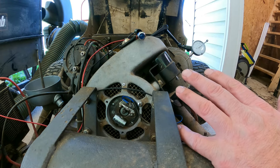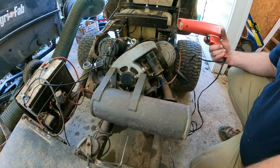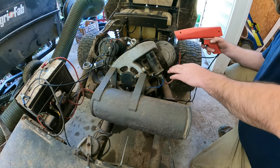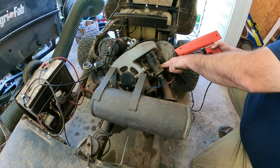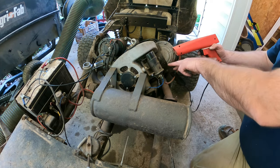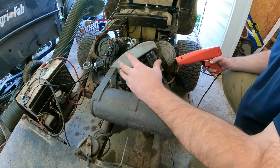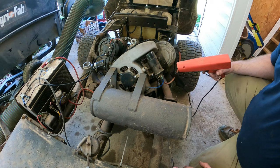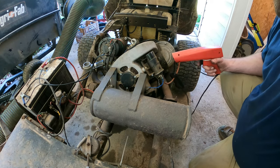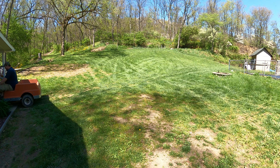One other thing you can do to check the timing is use a timing light. Jack up the rear end, get the tires off the ground, start it up in forward and reverse, and shine the light down through this hole — you should see the timing indicator. Start it in the other direction, run it a bit, and you should see the timing indicator again. That tells you if the inspection plate is zeroed out where it should be. I did that and it looks pretty much dead on, so I think the timing and everything is good. Only thing left is to take it for a ride and see how it performs. We've got everything together — let's start it up.